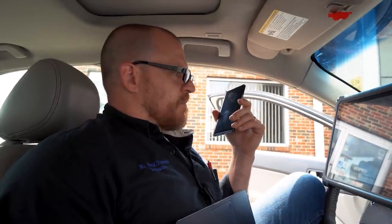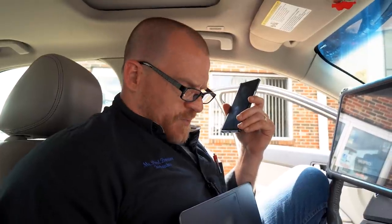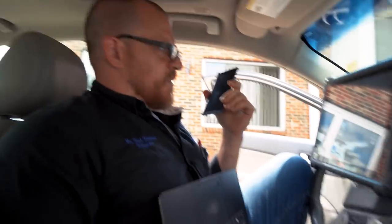Are you using the Snappy or are you using your own tool? I'm using the Autel. Yeah, because I remember I even read those things off to you. There was an outside air temperature, a duct temperature, and a duct temperature sensor. Well, the diagram shows it as EVAP discharge air temp sensor, which would probably be duct. I don't see a duct, but that's fine. All I see in my list is an interior temperature and an unfiltered external temp sensor, and they're both like 80 and 87. And right now I have an EVAP temp sensor that's showing me 39 degrees and the status is off. And as soon as this temp sensor jumps back up to above 40 or 45, I wish I would have turned on your other tool just to see what I saw. Because when I saw it, it wasn't that way, but that's the way it was acting. And that's why I was like, it almost has to be a module, but maybe I was looking at the wrong parameter then. Whatever, I don't care.